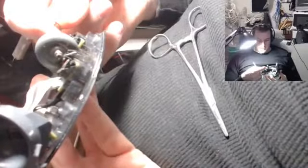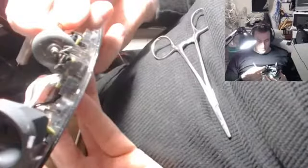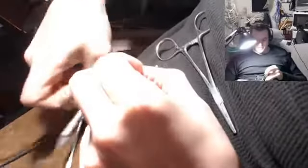The spring is not tensioned properly, so I just opened up the button assembly and attempted to retension the leaf spring to make it more tense. Unfortunately, I bent the spring out of shape pretty badly, and I don't really understand how to reassemble it just from looking at it. So I opened up a good setup to compare what I'm doing, on the right mouse button.